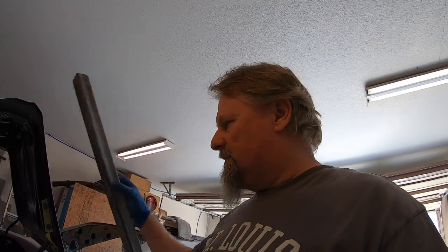Couple of tips that I've learned throughout the years doing this kind of thing. You see this kind of technique being done all the time in hot rod shops, where they put a skim coat on and then they use long blocks like this, only not as deformed as this one is. And they use long broad strokes to make the panels as flat as they can possibly be. You know, these 60s muscle cars aren't known for really tight panel gaps, and especially these little A-body Mopars. The panel gaps aren't great on these cars. But if given enough time, you can make them really nice.